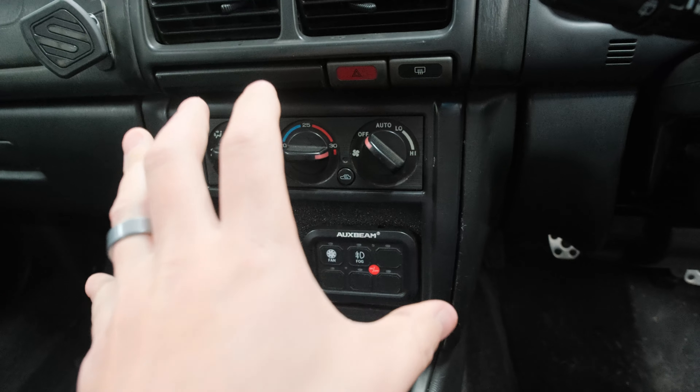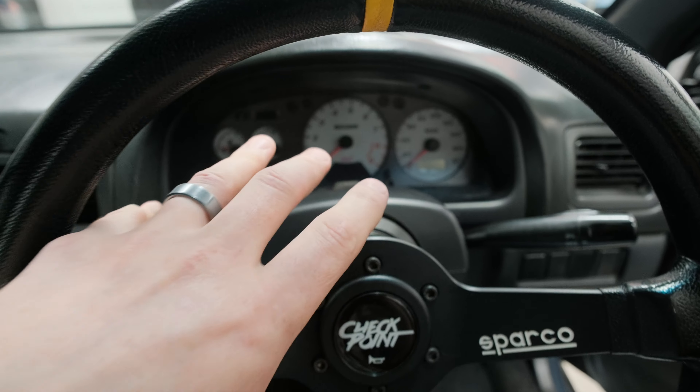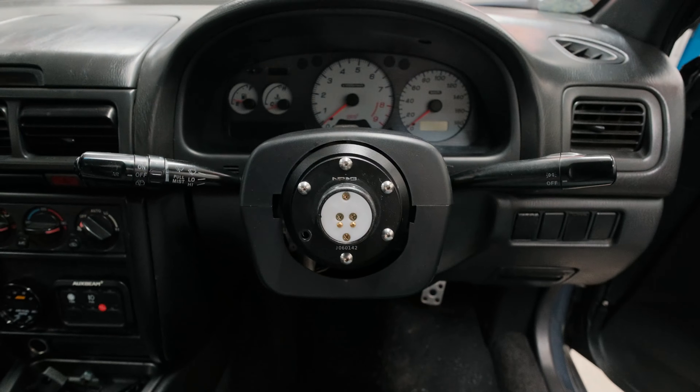I might actually knock that out today — just rip the dash out, it's not too bad. I will take the center console out, the shroud around the steering wheel, the steering wheel itself comes off pretty easy, and then the lower kick panels and the glove box. All in all, it probably takes about 45 minutes to get the dash out and get everything unplugged now that I know how to do it. So we might work on that first, get the dash flocked, leave it out to dry, and put it back tomorrow. I'm going to poke around, get a plan formulated here and start working. I'm really excited — this is going to be a very fun adventure. The adventure always starts right here, turning wrenches. Let's get to it.